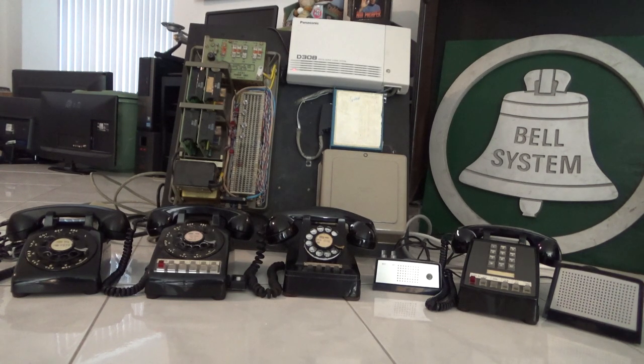The transmitter controller on the left side of the 2565 set has an on/off switch on the top left — an off button and an on button. When you press on, it lights up and the speakerphone goes off hook on whatever line is pressed on the six-button set, including intercom. If you hold the on button down while on a conversation, that also acts as mute — it mutes the transmitter without disconnecting the line, useful in conference settings.